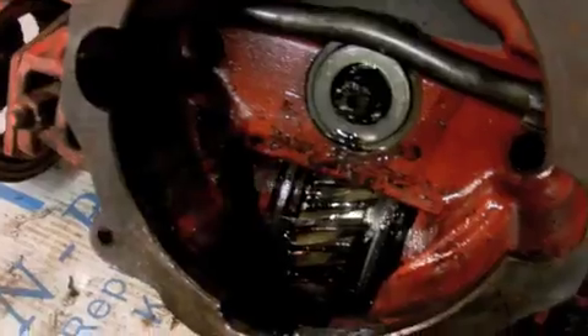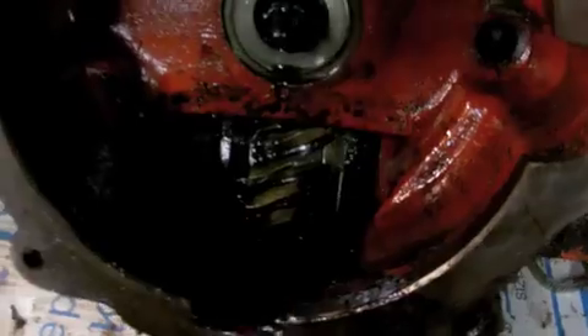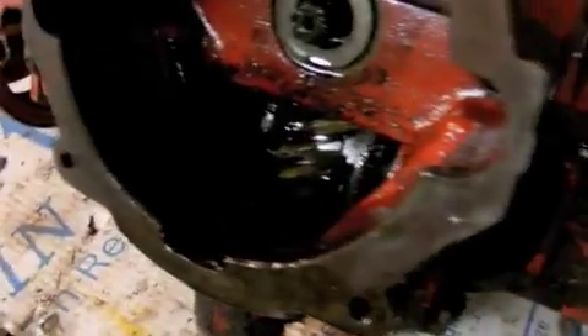These ones are both red whereas my other ones are yellow, and they're a little bit newer because you can see they have the cutouts on the ring gear for oil, which is kind of nice. Unfortunately the inside is a little more dirty than I wanted. I was looking for a couple of clean ones that would be quick to put together, but I'm gonna be doing the same thing I did with the first video - pulling the axle housings off, taking the differential out, cleaning everything out. This stuff should wipe out pretty easy because it's very oily.